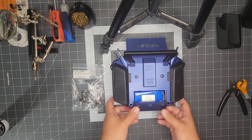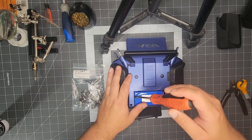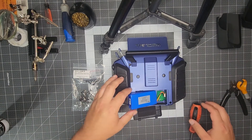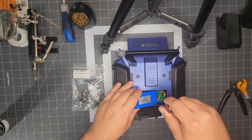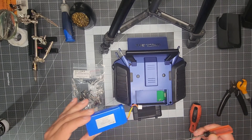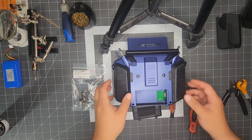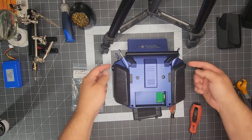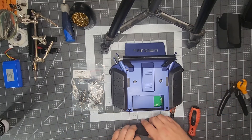Turn it around — battery cover, you need to remove that. Instead of tugging on the wires, I found it to be a lot easier to just get a flathead screwdriver right on that tang and you can easily pry like that without risking pulling the wires out of the connector. You can leave these covers on — these are not required to remove. Some people do prefer to remove the sliders as well, but I've found that's not totally necessary.